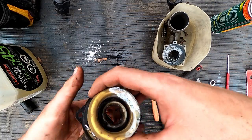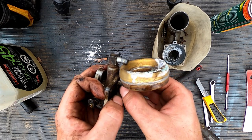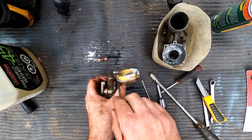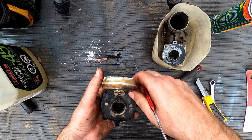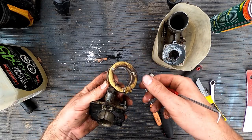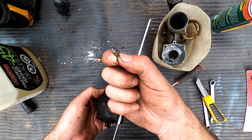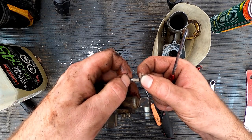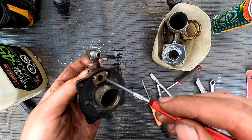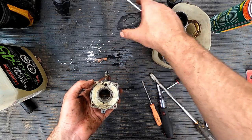You're going to get soaked, and we'll get the float off. Float pin. The float. It's nice to see a brass float. When you work on old stuff, you see them all the time, but that's the last of a dying breed. And the needle valve, this one is rubber tipped, so that's it. And it looks like there's a little rubber over here. We don't want to disturb that too much, because sometimes if you take them out, they end up inflating and they won't come back together. This guy we're going to leave over here. We're not going to soak the gasket.